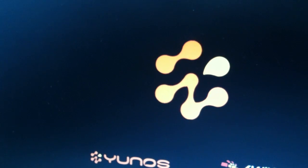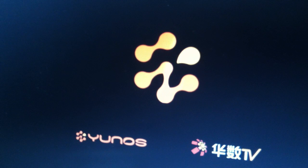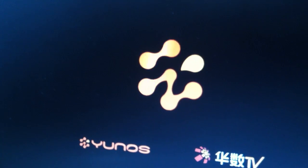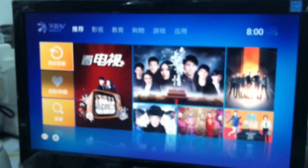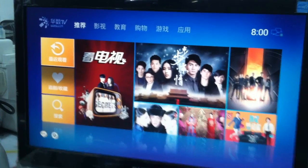Okay, here's some clue about some problems. If you see the logo in the middle has a black line in here, that means your device is only hanging. Then you just restart your power, meaning you unplug the power cables and restart it. Then it will normally go to the main page. So don't worry, you have not crashed your device.